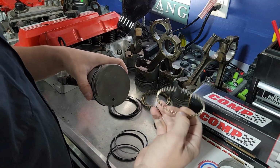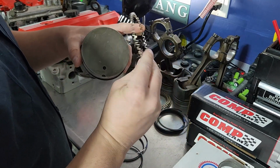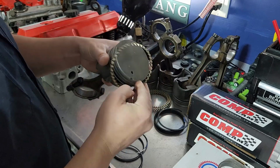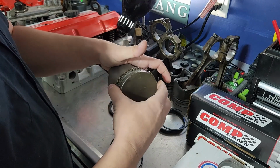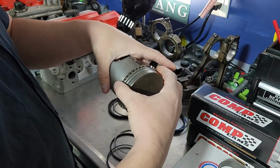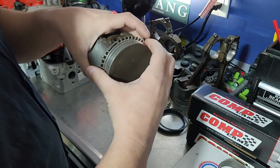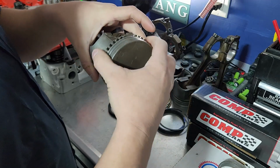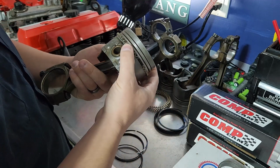Same deal with the corrugated ring, the oil scraper ring. Again, always look and see if there's something that indicates top or bottom. To be perfectly honest, it's not going to matter. And this one, you're really not likely to break. You just push it down and get it in, as long as it goes into the channel it's supposed to go into, and it is sitting in here without any significant interference. Everything has to sit in here flush.